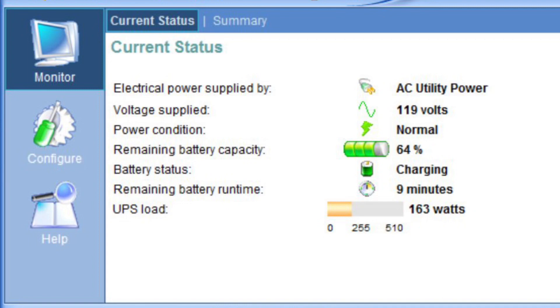Why have a CyberPower UPS connected to the EcoFlow, with the EcoFlow connected to the wall? The reason I'm still using a UPS is because it has a USB interface connected to the computer, so if the EcoFlow ever shuts down or the battery depletes to zero, the CyberPower will shut the computer down in a timely manner without crashing. That's important.